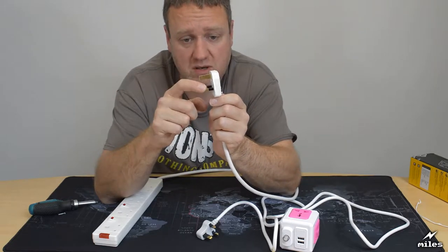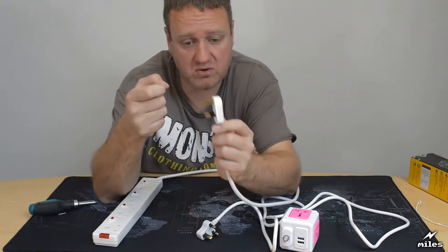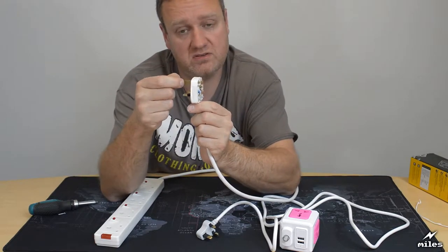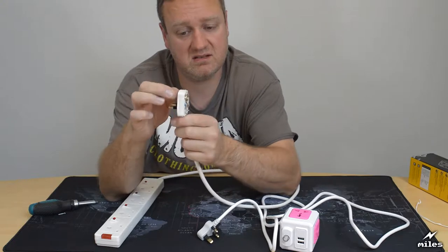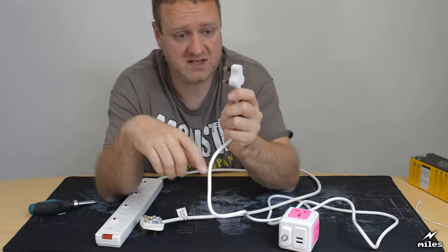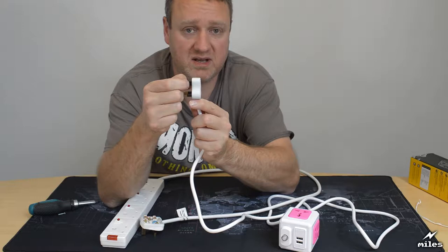That's why these are shrouded and this one isn't, because the contacts within the socket that this bites into are very near the surface of the socket, so it bites into it first, and then as it slides in, it's holding it near the end. That's invariably how it is. So this one will always make contact before these two. So you've defeated it by having a shroud, because yeah, that will connect as it goes in, but then it'll move past it.